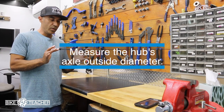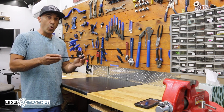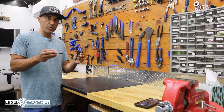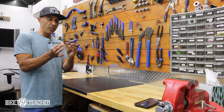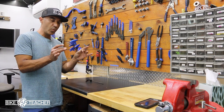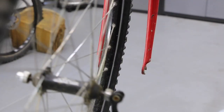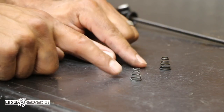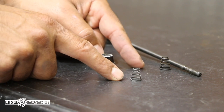This is a 9mm skewer — a typical skewer with a quick-release lever. You'll find these not just on lower-end bikes but on older bikes from the 70s, 80s, 90s, and early-to-mid 2000s before we started going more toward thru-axles. It's real skinny in the middle with a little lever, and these can vary in look. Usually you've got an end cap and then two coiled springs that are cone-shaped — pointy on one side and wide on the other. These two coil springs are meant to help center the skewer automatically, keeping it right in the middle, not off to one side.